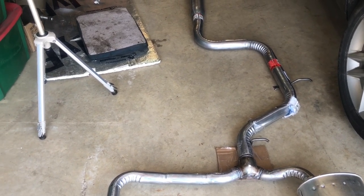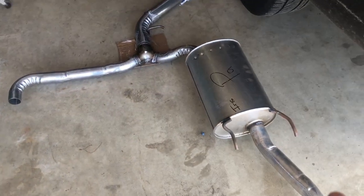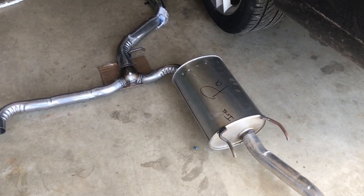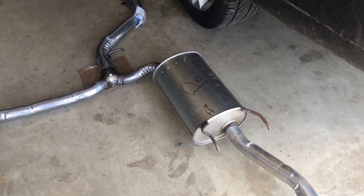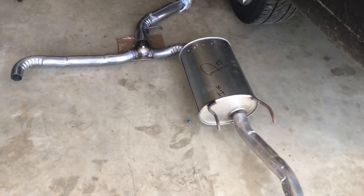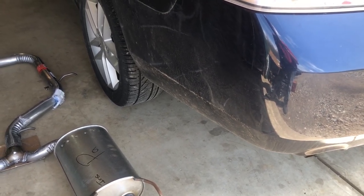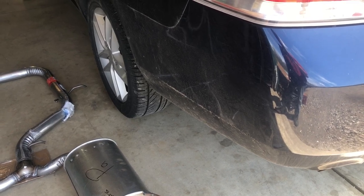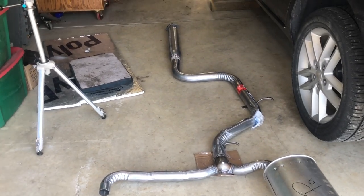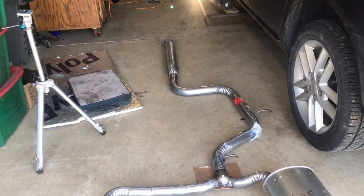I also had a $20 credit, so it was actually down to $22 with free shipping. The mufflers were like $32 a piece — I had actually ordered three mufflers: two for this car and one for the Copart project car. So basically what we're going to do today is undo the clamp and pull off the good muffler, then cut the bolts on the resonator-to-catalytic-converter connection, pull the intermediate pipe and the resonator out, and replace it all with new.